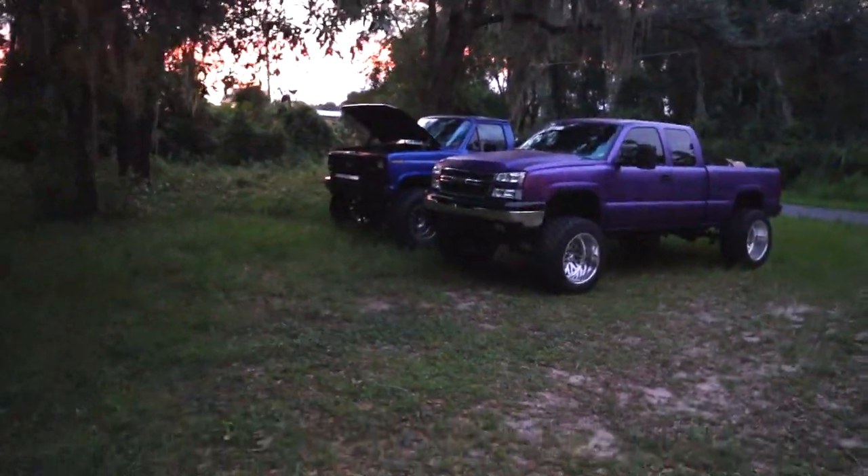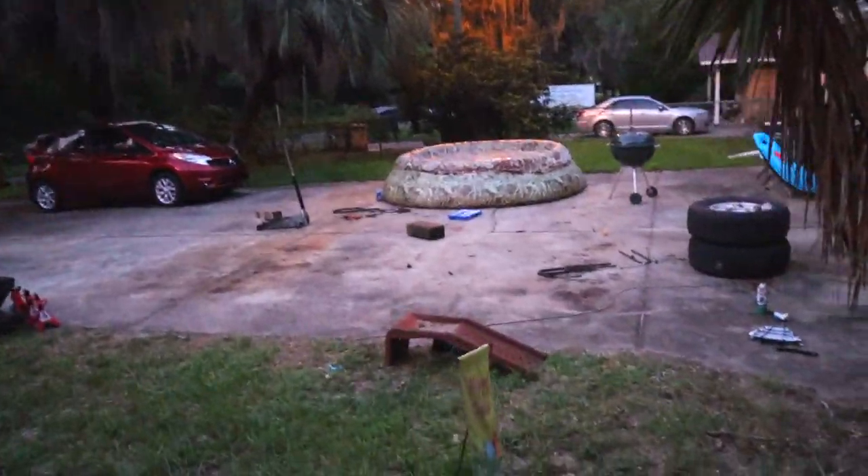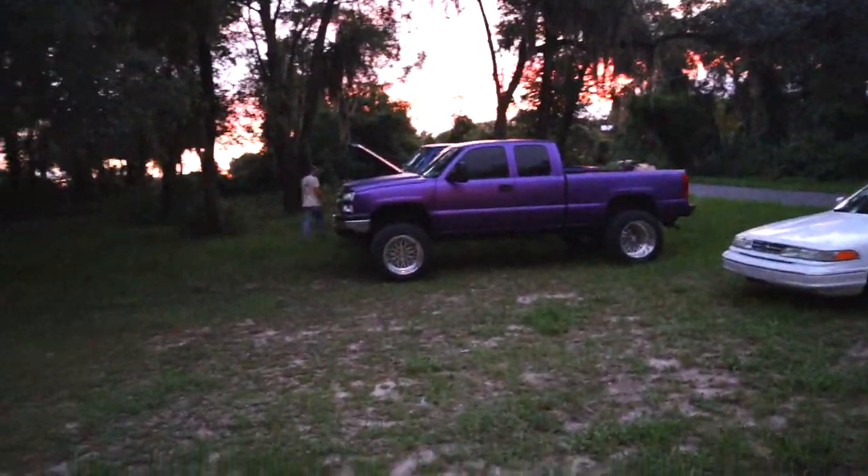As you can see, the Ford is out of the driveway — first time since February this spot has been empty. Sadly, the Ford still does not have reverse in the transmission. It's really weird — it's there but not there when the tires are straight. It'll back up on its own when it's cold, but when it's hot and the tires are turned going uphill it will not back up. That's going to be something we figure out in the next video. I'm going to close this out before it gets any darker. Thank you all for watching — hopefully you guys like the shorter style videos. If you did like this video, hit that like button, hit the subscribe button, turn on the bell so YouTube notifies you when I upload. Catch you guys later.